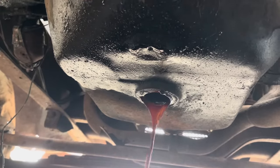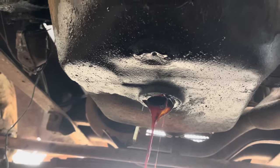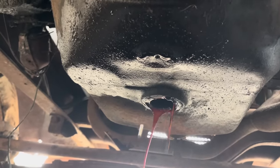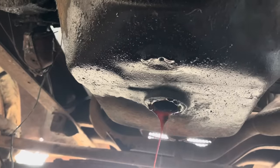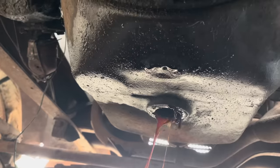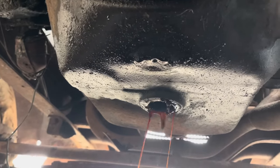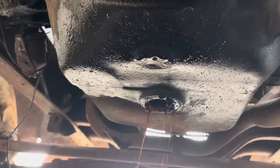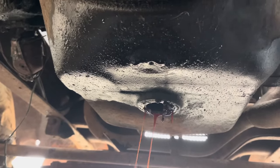and clean it out, and we'll make sure we flush the oil pan, make sure it's clean so we don't run that through there, because it will clog up an oil filter once you break it free in about 2.9 milliseconds. That's why if you're running an old engine that hasn't ran in a long time and you don't clean out the pan, you want to run a non-detergent oil, or all that stuff will end up in your oil filters and all the oil galleys and the main bearings.